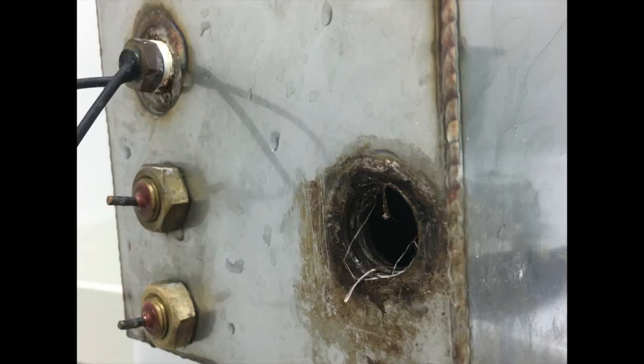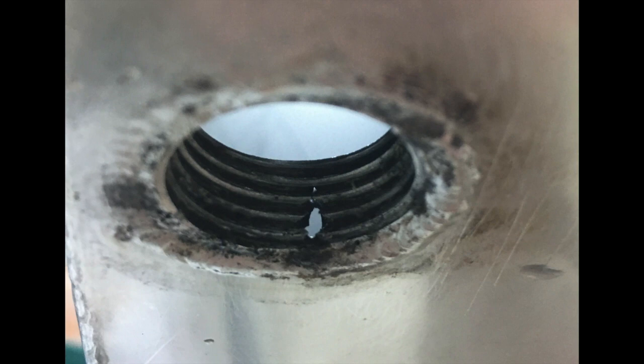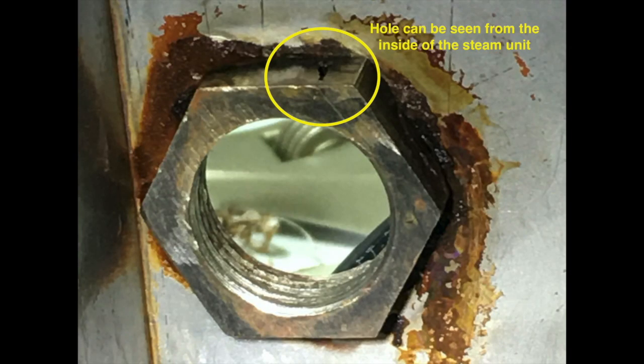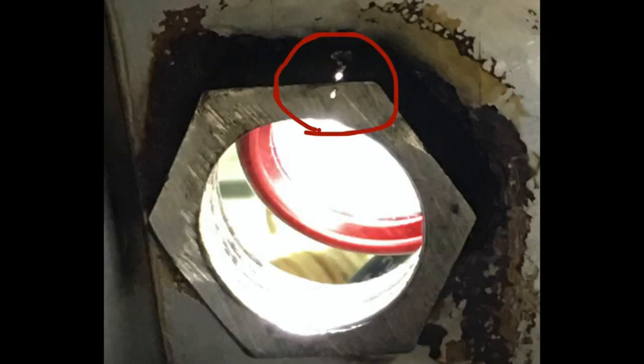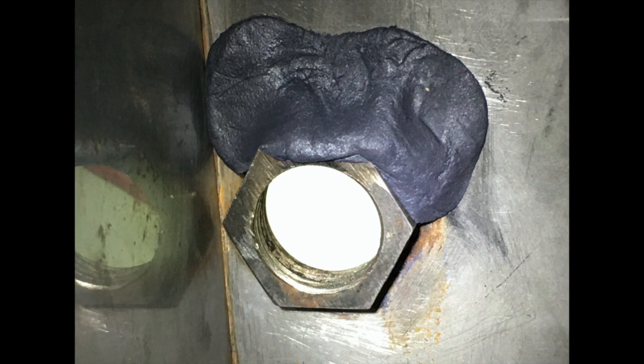I unthreaded the float switch — you can see it here. The threads aren't very good; I tested it and it seemed to be working at first but it wasn't actually in the end. The thread had a lot of corrosion and you could see it here — even light can go through it — and I needed to fix that because otherwise it would leak. This is the view from the inside of the unit; you can see the hole on top. So I used epoxy putty on the inside of the unit to block that hole.